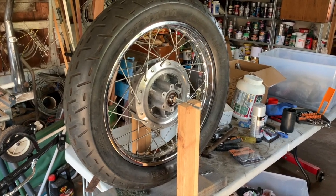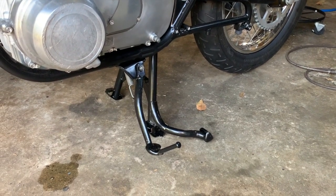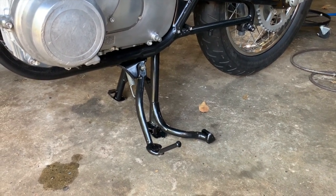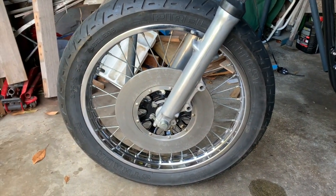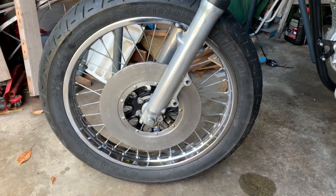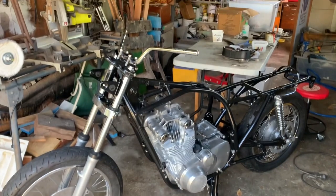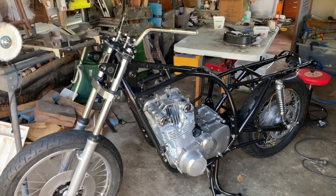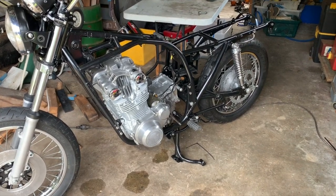This wheel did have a couple of wheel weights on it before but they fell off, so I've got some new ones coming. It's just a matter of rotating until you find where the heavy spot is, putting the weights on until it balances and doesn't tend to fall into one spot. I've now managed to put the center stand and the side stand on and connect up those springs, which was a bit difficult. I also tidied up the front wheel, gave it a bit of a paint job around the disc, and the front wheel is now on. It's now sitting on its center stand.